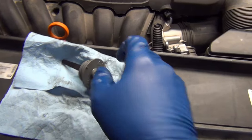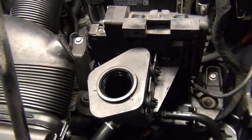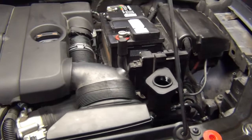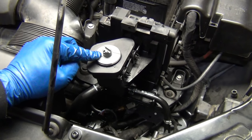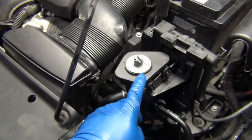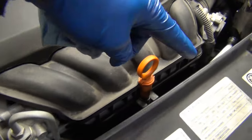Of course you've got air trapped in there — I just filled it up and all of this bottom part is full of air. It's got a little hump, like a Ford Ranger French clutch over-the-frame kind of hump that you've got to bleed around. So you've got to run it, check it, run it, check it. There are easier ways to do this — it doesn't have to be this complicated, but being complicated gets you into the dealership to buy a new one. If it's getting really bubbly, let it sit for two or three minutes. Turn it lock to lock after running it for five seconds — that'll help spit up some more air. You want to get all the air to the surface without it running and making a bunch of noise and making it worse. That new line is doing the trick — it's not sucking air anymore.